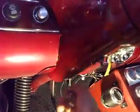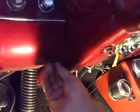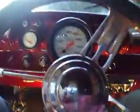So what I did, instead of taking both sides off, you can just take the nut off of this side and bolt, and the C-clamp will just fold right over. Loosen that in just a little bit. Now once you've done that, so 1, 2, 3, all you got to do is get up here, set in your steering thing, take your knees and pull it back.